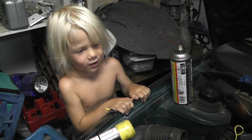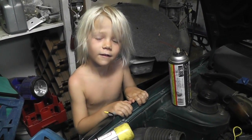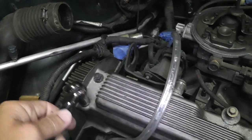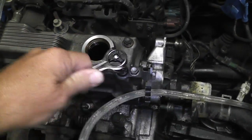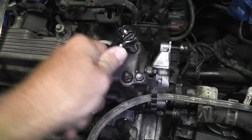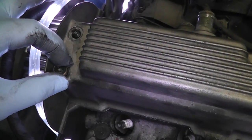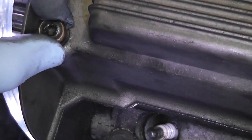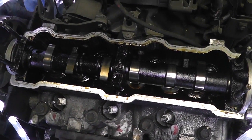The next thing we do is take off the four valve cover bolts with a 10 millimeter wrench — just like that, pretty easy. We'll take them all the way out of course. Under each of those 10 millimeter bolts is one of these little oil sealing washer deals — I just took a small screwdriver and pried them up. And then the valve cover just lifts off. Look at that camshaft — it's drippy.